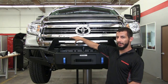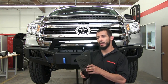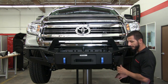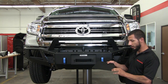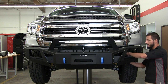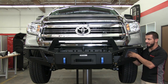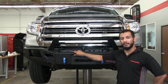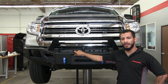We've finished the install on the optional light bar. You're going to want to install the mesh cover that covers the winch as well as the side access panels — just match those up and bolt them in accordingly. The last thing with this install is the light plates. Keep in mind that because this is a dual hole, it has to be installed from the back side to cover the hole that's not going to be used. Then just make the alignment and bolt it in place. From then on out, you're pretty much ready to enjoy your BR5 bumper. Thanks for joining us here at the Go Rhino Garage — for more videos, please visit our YouTube channel.